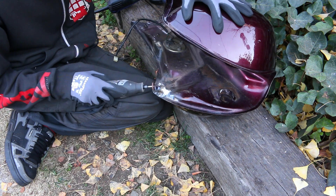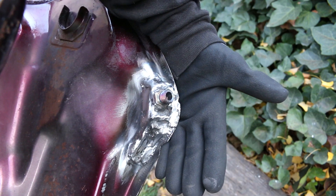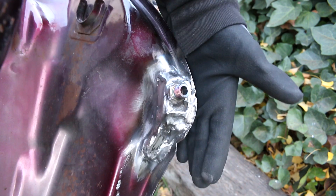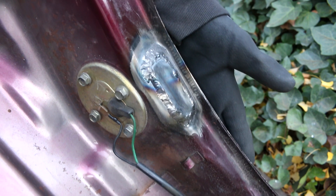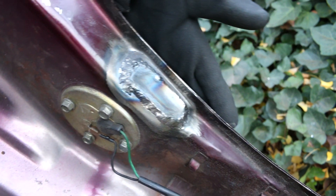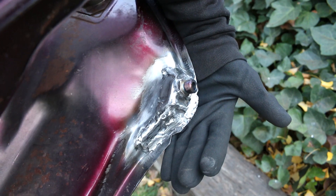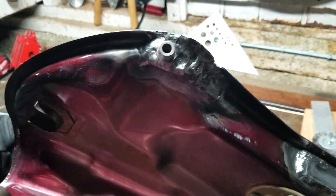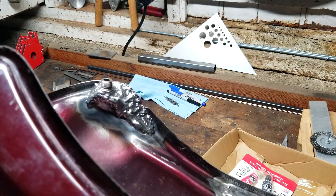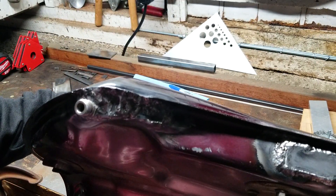You'll notice the patch I used is completely different because I went with a totally different piece of metal that was larger and easier to weld to. I also went with a totally different fuel valve because this one was a lot easier to get into the position I wanted, so I had to patch that gigantic hole with the smaller fuel valve. In the end it worked out, although it took a very long time and it looks absolutely terrible. I had a ton of material built up because some of the places I was welding were very hard to get to up against that seam — I just kept building stuff up until I had something substantial enough that also didn't leak.